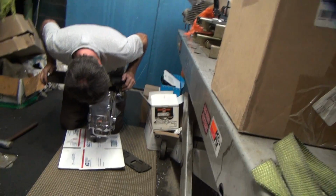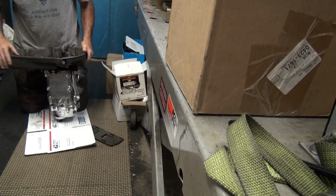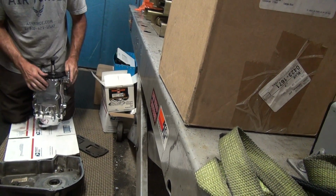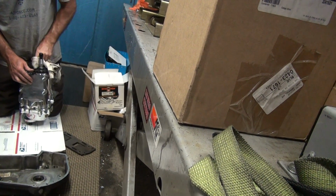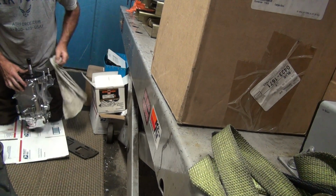It went down all the way though. Yeah, it'll go all the way. It's just what you gotta do when you put a belt drive on a shovel head. The nuts right up against the seal though. Alright. Well, I just needed some CRC then. Then we'll go to hammer. The seal hits on the nut, I think. So the seal probably went in slightly deeper maybe also.